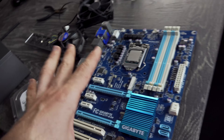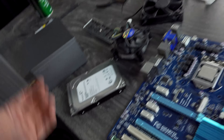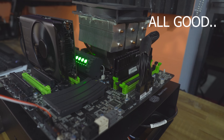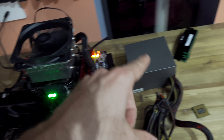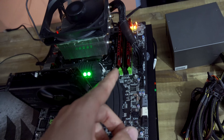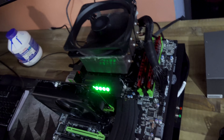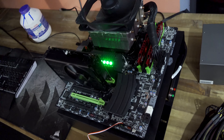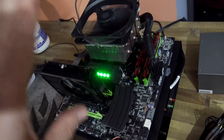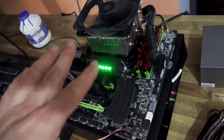At the same time, I'm hoping everything else in this build works because if it does, we've got 16 gigabytes of RAM, an i7-3770, a cooler, hard drive, and power supply — really worth it at that price. Interestingly, the motherboard doesn't support Corsair Vengeance memory in dual channel, so we had two single channels on the left-hand side work fine. But the G.Skill Ripjaws work fine in dual channel on this board. Just another case of Gigabyte's lovely BIOS. This is a high-end board — it shouldn't have this problem to begin with. But regardless, everything except the original motherboard is working absolutely fine.